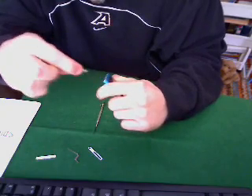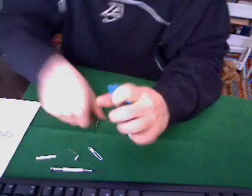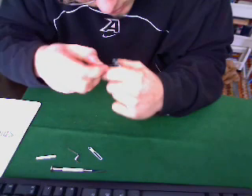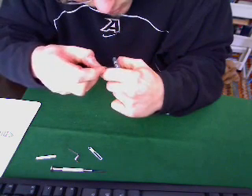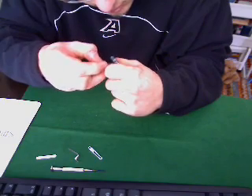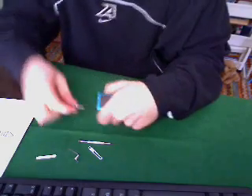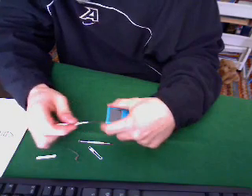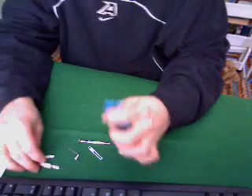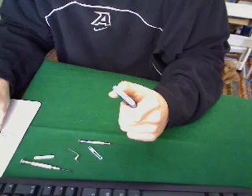One. That glue that is holding the hold switch on is actually covering the last screw. Try not to scrape all the glue away, but you're obviously going to have to remove some of it because you can't really do much when it's covered in glue. And the second screw was almost as easy as the first. Now we've got the two screws out and we are going to continue with the disassembly.